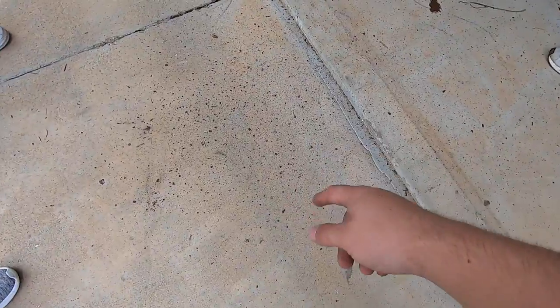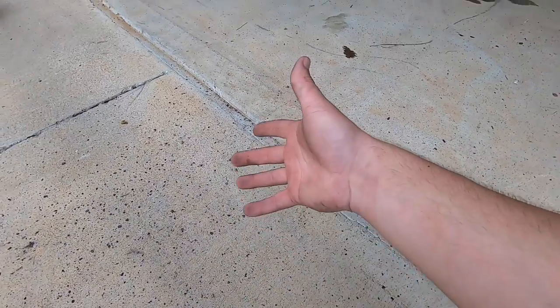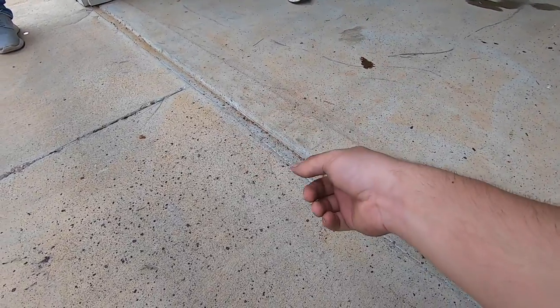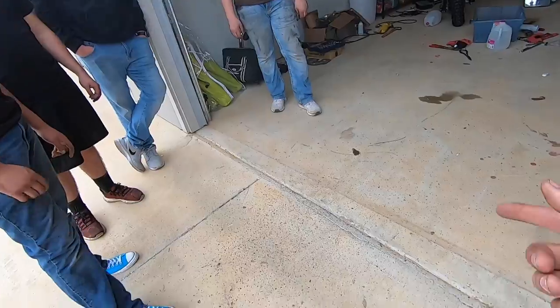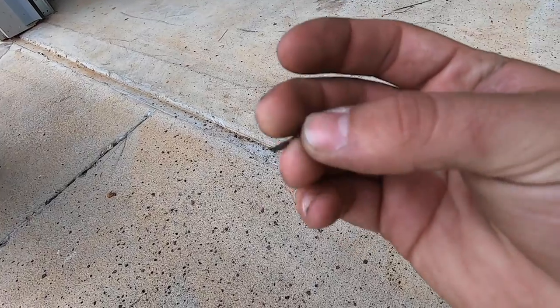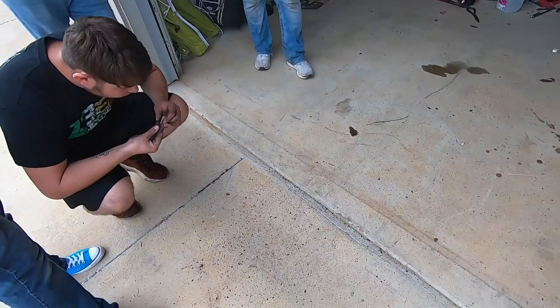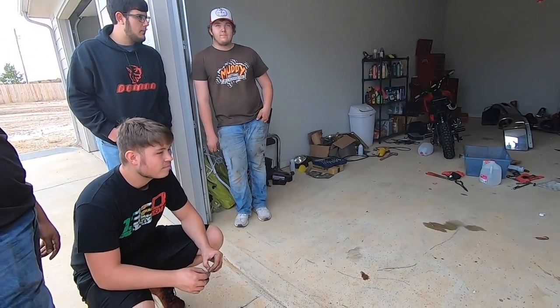That's the transmission. My guess is this right here, bro. That is what I think it was. I think that cat was clogged. Either that or it was open. Like the pipe was rusted out and it might have just been blown exhaust, or the transmission fluid could have went in there. But I'm saying, I think the pipe was rusted and was just hitting the body panels. Yeah, this is platinum, bro. Yeah, we had a whole culmination of problems, but my guess is the cat was clogged and the exhaust couldn't get out and got way too hot.